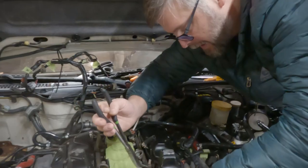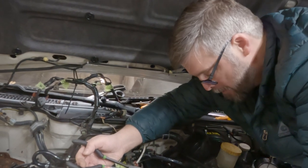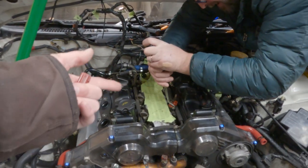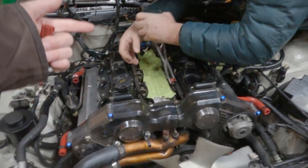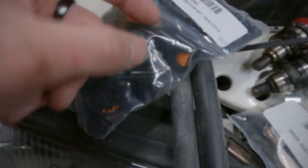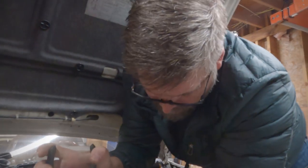We talked about all the work to do this stuff and decided to get all new injectors, since two of them were already problematic. We read so many people talking about replacing one, then another one, then two more, making three trips — and we were like, no. There were lots of horror stories about early model injectors failing. Not only that, the clips for the early model injectors suck. Having these nice plastic pinch-clipping style connectors is worth the money on its own. Good purchase — hopefully it fixes the misfire as well.